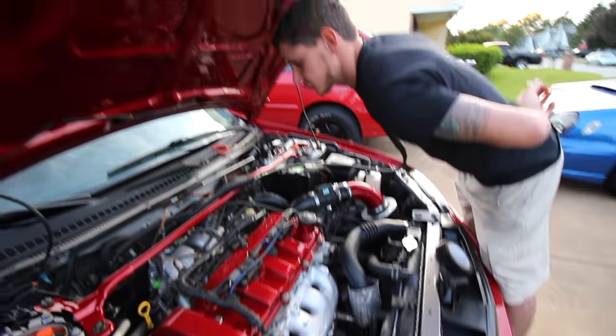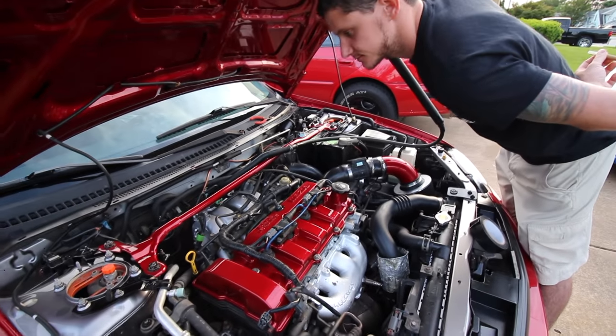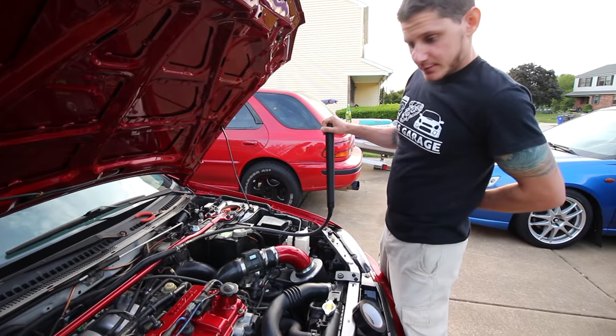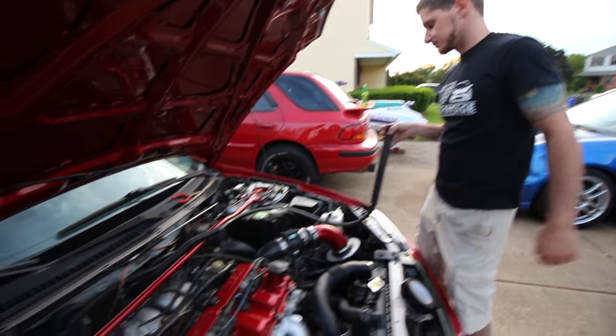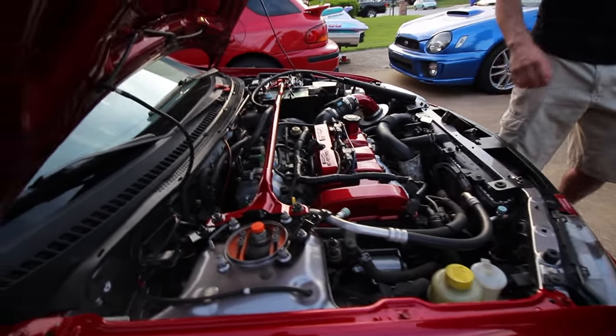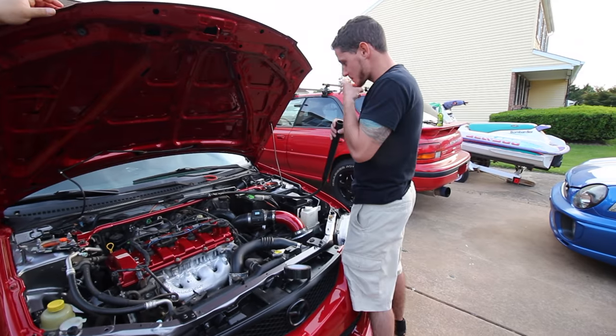I don't see any smoke coming from anywhere. So I'm gonna go ahead and assume that my vacuum is good. I think it's this wastegate because I've had problems with it before and it's old and rusty. Check mine while you're at it. Yeah, we can do yours too. I think you have a vacuum leak. I do. All right, let's try this again.